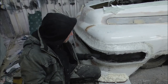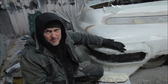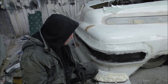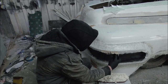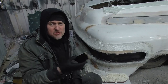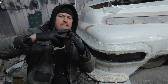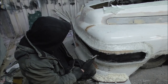So, I've had a few problems with fiberglass and getting tight corners on it. What happens is, you try to get it to go round the corner, you get like a lump here and a lump there. And I really need this to be flat. And also I've been doing quite a lot of upside down fiberglassing recently. I found that you can put filler over the fiberglass and it stiffens it up. Of course, you want to be taking most of the filler off. It's just to sit there to hold its shape on tight corners and then go over that with fiberglass resin. And this seems to hold it in at that nice sharp angle. Obviously the resin comes over and it's got it all. So that's what I'm going to try on this.